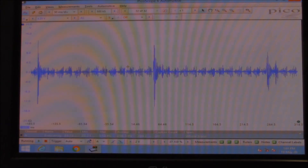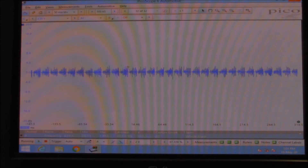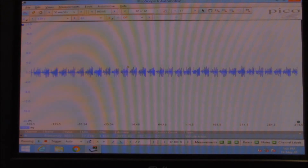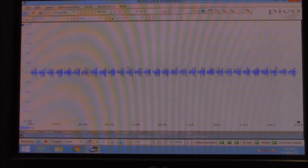Now I'm just tapping it with my fingernails. That's how sensitive it is. But have a look at the noise associated with it — I've got it on a frequency setting as well and it's picking up all the noise. That's just my fingernails. This is an extremely sensitive sensor, but as I mentioned, the problem is it picks up a lot of background noise which the ECU can misinterpret.